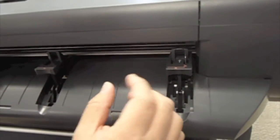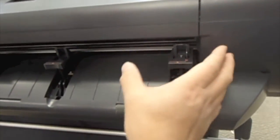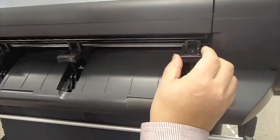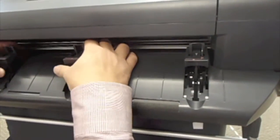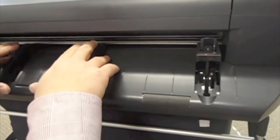When the media is aligned, I believe those little orange alignment lines help you align that media for correct print operation. So these little media holding guides here pop up, and as the media comes down or is set and begins to print, these will actually hold that rigid board up.